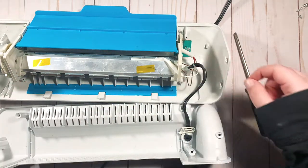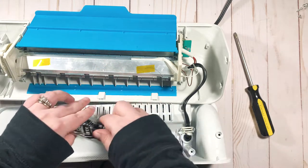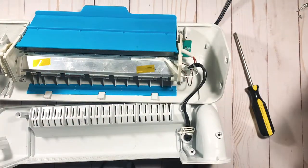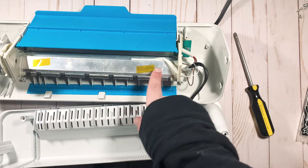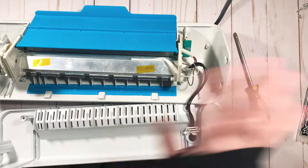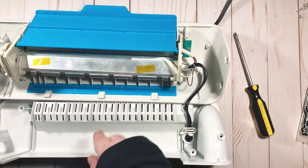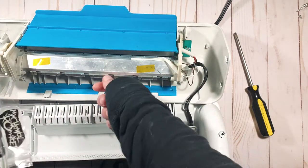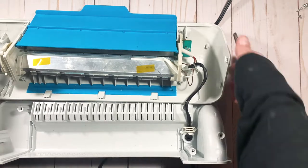When I got to this point I saw my jammed laminating pouch sticking right out of there — it was rolled up in there pretty good. I just very slowly kept pulling it out until it came completely free of the rollers. The biggest thing is just getting the machine apart. Don't do what I did and try to pull it through the front. Don't mess with any of the internal components — just pull whatever is stuck out very slowly. If it's particularly hard to get out, you may need pliers, but I just used my fingers.